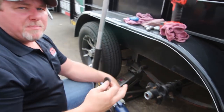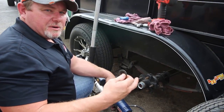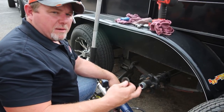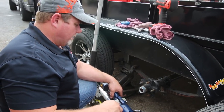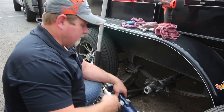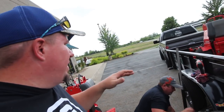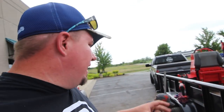Another thing is the type of grease — you definitely want a high-temp grease. There are different greases on the market, but a good high-temp moly grease is probably the best we've found. We use a Lucas-branded grease, but definitely go with high-temp grease for the bearing temperatures you'll see in that little hub. Also, if you're watching this and you're running boats, you may want to check out marine-grade grease. There are definitely a lot of different types of grease for every occasion.